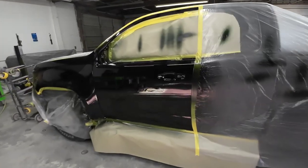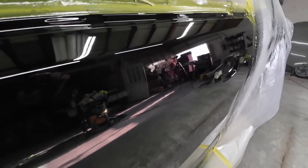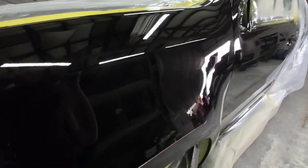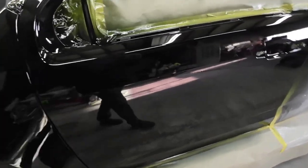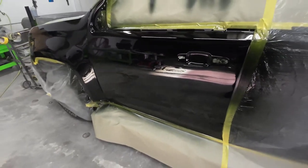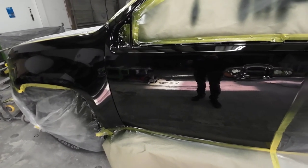It's Monday morning — we painted this truck Saturday. I just wanted to give you an idea of the finish. No dieback on the urethane clear, so that looks good. It's got some particles of dust — it's not perfect, it has a little bit of texture in it, nothing more than factory. I am going to cut and buff some of this dust out. There's a little piece of lint there. Overall, this repair came out beautifully. We're going to cut and buff this, unbag it, get it outside, and take a look at it.